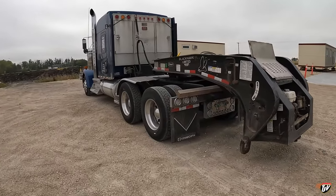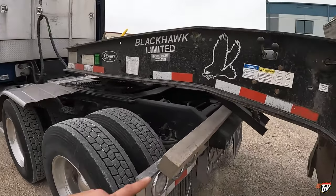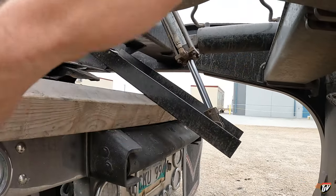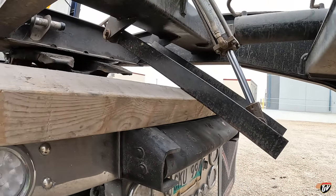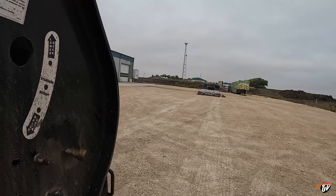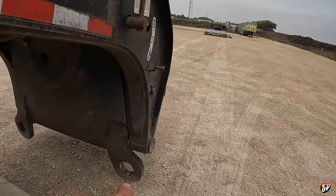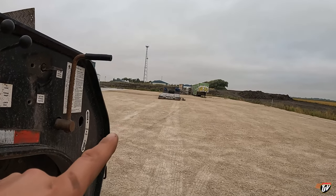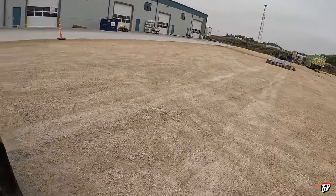And that's what we mean by removable gooseneck — it just stays on the truck. Like I was explaining yesterday, this thing is supported by this here, and I put this 4x4 across here so that the weight of this thing sits on my frame and not on this little thing here, which is not made to hold that much weight. I drove perfectly straight forward, so once it's time to hook back up I just follow my tracks, hook right back up, and put those two eye rings in line with those — I guess what you'd call them — big nipples over there.